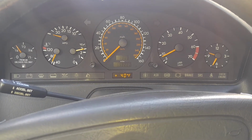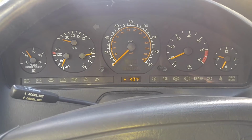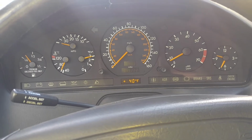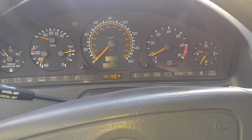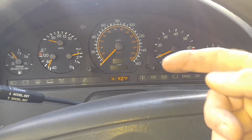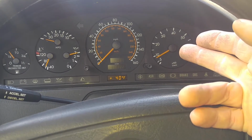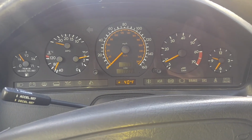I mean, your mechanical fan, coolant fan is always engaged too. So it just stays engaged, so therefore it's a little loud. Probably better to have it engaged than not engaged, because then you would overheat. But obviously, ideally it was designed so when you reach certain RPMs, like 3,500 to 4,000 RPMs, and when the engine is cold, then the fan isn't engaged. I don't know what happened there, but if you don't race the car, you'll be all right.